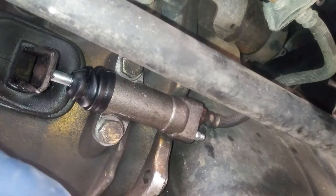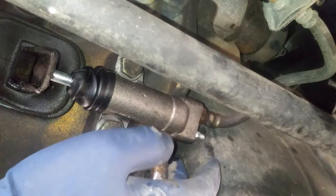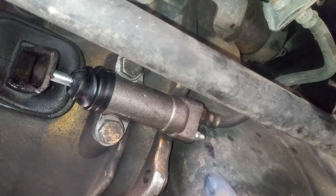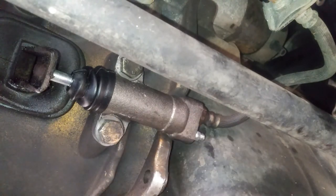After they're done pumping it about 30 to 50 times, make sure that they press and hold it. When you release the pressure at this little bleeder valve and close it right back up, then they can start pumping again. We don't want them to let go before you close it because as soon as they let go, it's going to suck air back in.